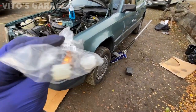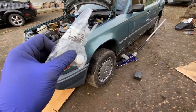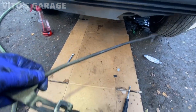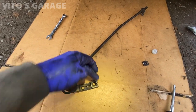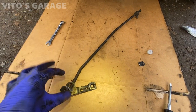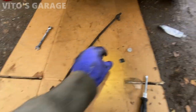These are the bushings that we have to replace — both of them. I took out the linkage, I'm gonna be washing it, and this one actually came out from the transmission. It's pretty simple: it's just a 10mm bolt and nut on one side, take both out with the washer, and this pops out. Now I can easily install the new bushing.